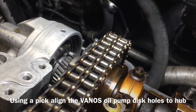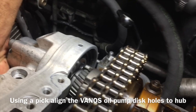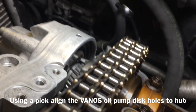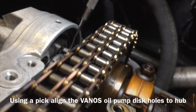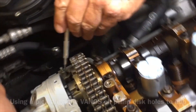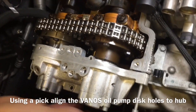Now we can slide it in a little bit further. What they're going on are those original teeth — that's where the holes go in. Here are the original pump holes, and here are the new ones. We're going for the new ones, and I marked them. Remember, those are the smaller ones and they have a tighter fit. We're going to reach in with the dental pick, line these teeth up, and there it is — it's all set.